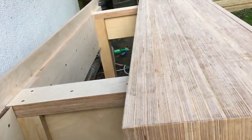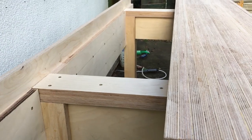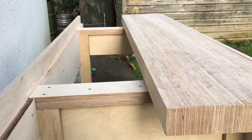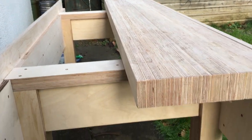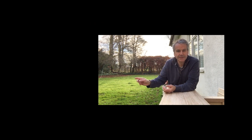There will be some bolts on the side here that'll basically cinch it all up nice and tight. I've got to do the well board, and then there's a runner along each side which makes it a little bit wider, and there's a couple of bits underneath - a sort of bearer that goes along there just to stop the well board from bouncing up and down. Then of course got to finish it as well. Here's the cat just to say hello.